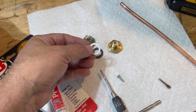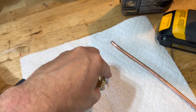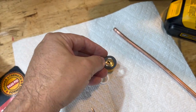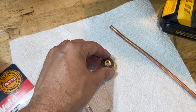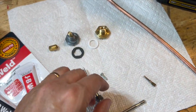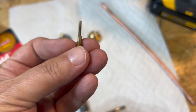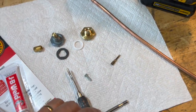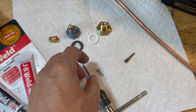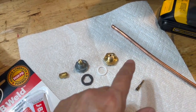Do be careful about how these seal up. You can see this one's kind of loosey-goosey. The one from the carb kit seals up so much better and it's much tighter — I really suggest you use that, or maybe even an O-ring that fits over there pretty good. You're also going to need some quarter-inch tubing — this is to pull one of the plugs out of one of the ports. I use JB Weld just to seal some things around the quarter-inch tube, and of course a drill and a drill bit.